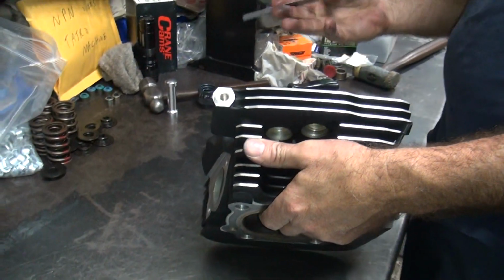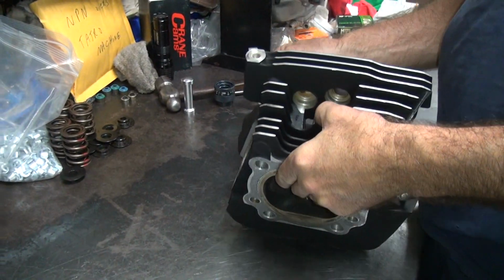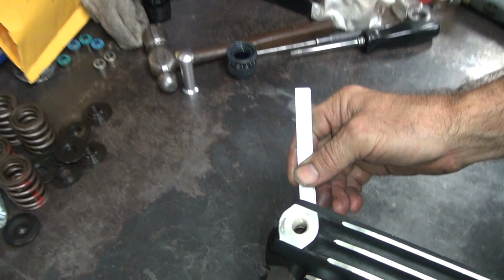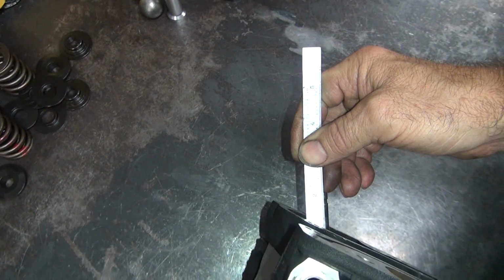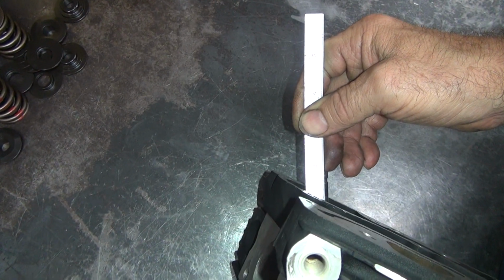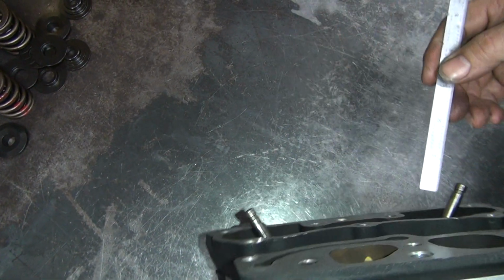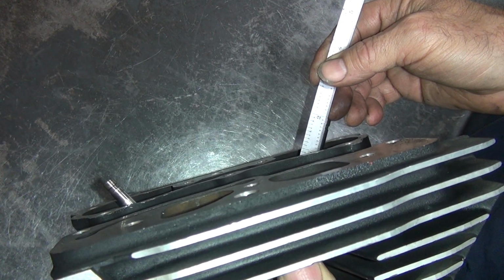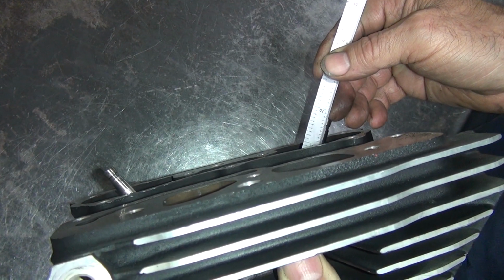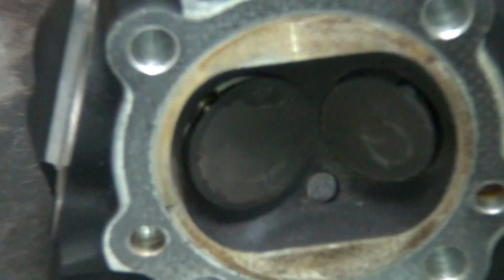Okay, so what's our TD left? Remember? I don't. You failed the test. 180. 180 and 190. There's one, yeah, 180, 190 is correct. So they're both the same height too. That's weird. These things haven't had any valve job done on them yet. So there's 200 on both. How's our clearance? Really good. Don't have to worry about that. Except 585 is easy to bolt together.